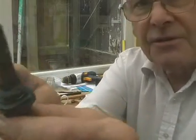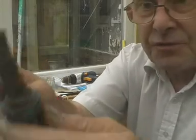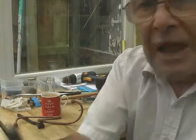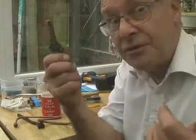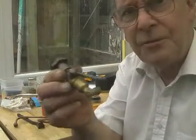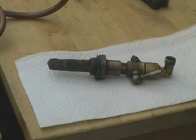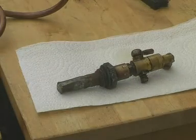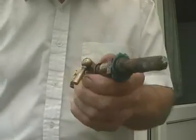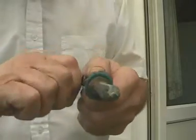I've cleaned the thread here — that blue stuff looks like silicone or something. We'll probably use some PTFE. The petrol filter looks a bit grotty but it's fine. It was never going to run anyway because I took the little plug off the top of the float chamber and it's bone dry — no petrol got in at all. So I wonder if a squirt of WD-40 might free up the cock. It's okay now — very stiff but working, and of course it does need to be quite stiff because petrol has a very low surface tension and can seep through things.